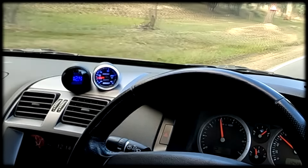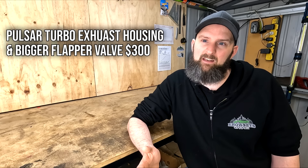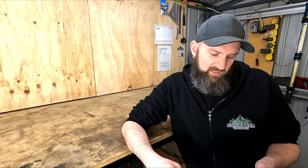That had it running all tuned up and most people would be set there. Not sure if it's my bad luck or if many more have had the same issue and ignored it, but I then also had boost spiking and over-boosting issues. I could see that ending in tears so I opted to try and address it with a Pulsar Turbos exhaust housing which has a larger flapper valve, and then we ported that myself a little, which has now sorted the issue. Alternatively I could have thrown bigger injectors in and just turned it up for more boost — but that rabbit hole is deep, and we have other cars waiting that need time and money for now. Those costs now blow out a bit, putting us closer to four and a half grand.